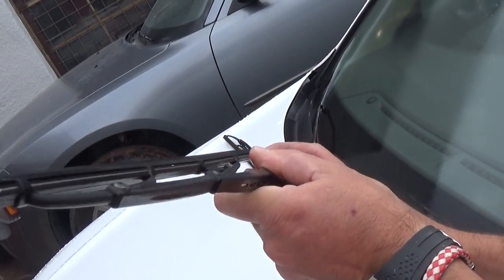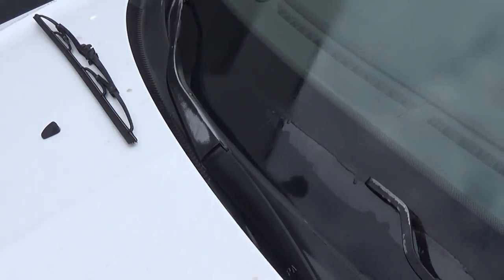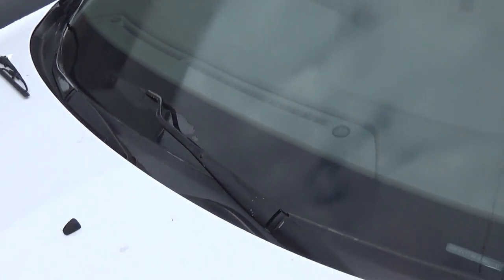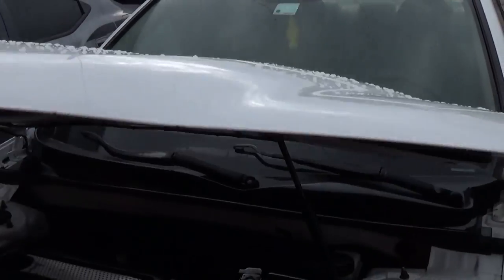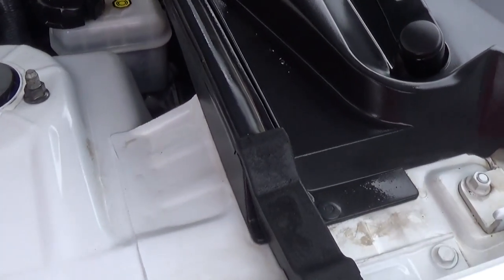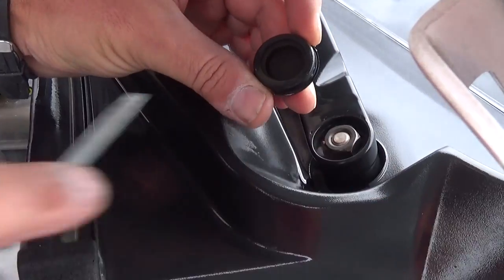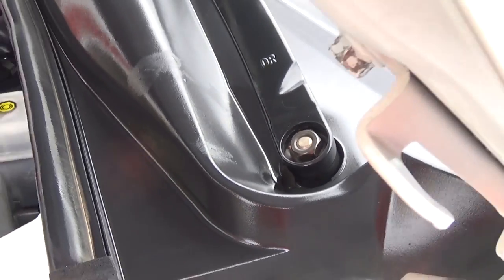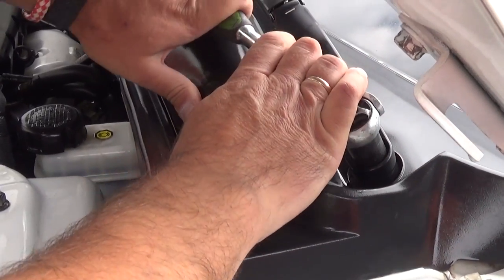We're going to remove this one as well and show how to remove the arms. We're going to paint ours because they look really bad — on every Hyundai the paint on the wipers is pretty thin so they eventually burn. What you'll need is a 17-millimeter socket for a Hyundai Sonata, but other vehicles might be 15 or 14. You'll have a cap that you need to remove, and underneath is the nut — use a socket and ratchet to take it off.